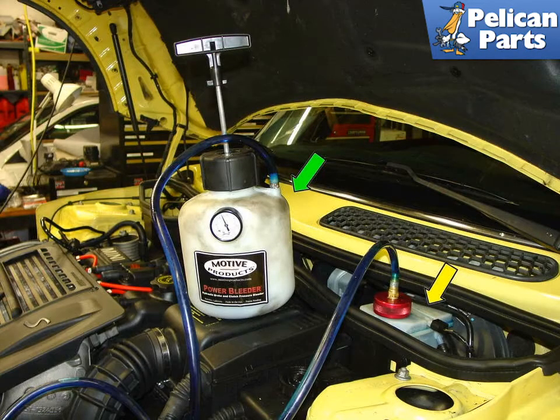When changing your brake fluid, always make sure you use the appropriate fluid for your car's braking system. Check your owner's manual and never deviate from the type of fluid it recommends. Some of the later Minis with ABS braking insist on a certain type of DOT 4 fluid. The use of silicone DOT 5 fluid is not recommended for street use.